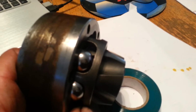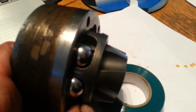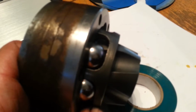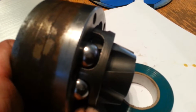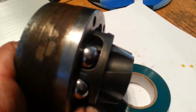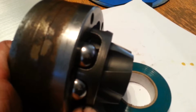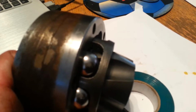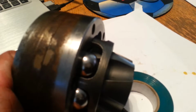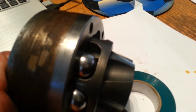Ball number 5. And from here, it gets really, really tricky. But the rules all apply the same anyways, is that you want to get your shaft, your gear out far enough that you can slip it in a hole with in that little indent to put the balls on, and get it onto the gear and keep it all together, and that'll be another little push. So yeah, on to ball number 6.